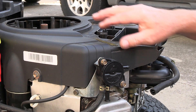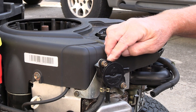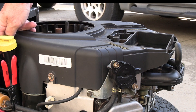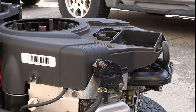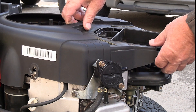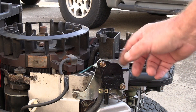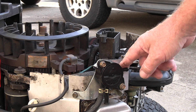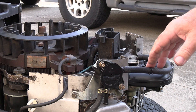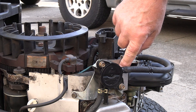Now I'm going to try and take this cover or shroud off without removing the fuel pump and see how that works out. I'm going to go ahead and remove this screw here, this one here, and the one back behind here. You don't have to remove the fuel pump, but you do have to remove the fuel line because it's in the way of this bolt right here. I'll pop this fuel line back on there to keep it from leaking, but you do have to remove it to make it easier to get this bolt out.